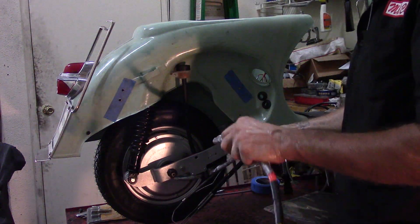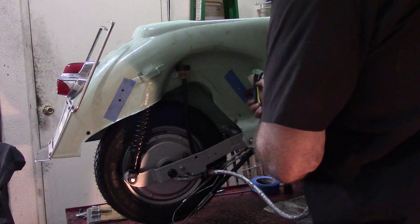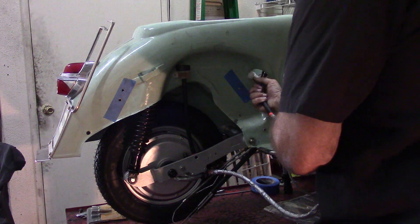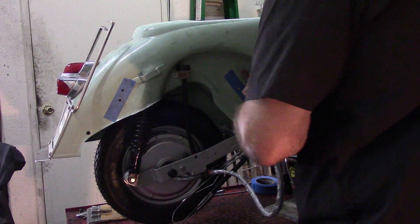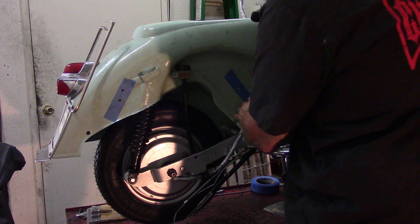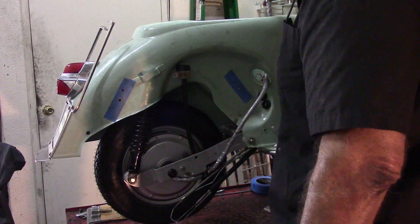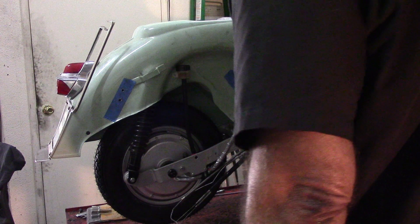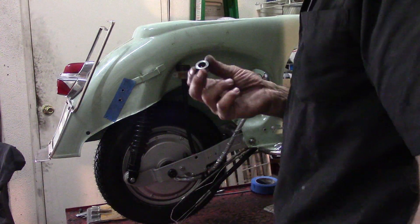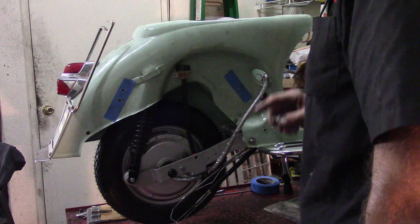Take the main cable wiring harness from the new motor and slide it through the air intake into the main compartment of the bike, making sure not to pinch anything. We're not putting the main nut on yet — we'll put that on after we install the battery box.